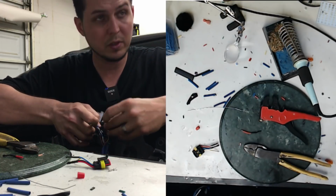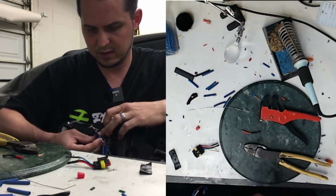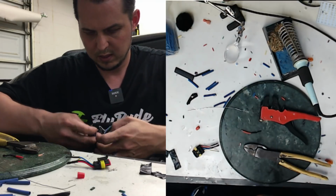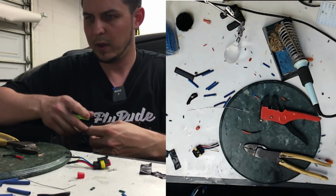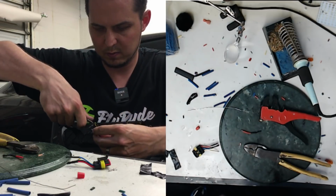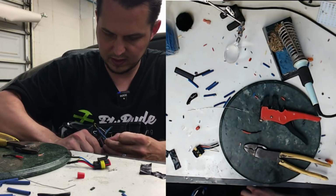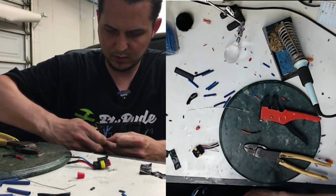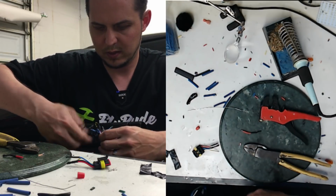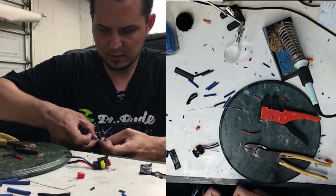So here's a trick for anybody that's listening. When I set up a strobe unit to turn on something like the white DRLs on a GTR, I need to put a diode on there because it's a secondary power source, right? So what that means is that I'm powering it the normal way, which is from the parking light on the car, but then I also am powering it from a secondary way, which is the strobe, and I don't want those two different ways to see each other. So you have to use a diode, and people that know electronics are like, yeah, no kidding, it's a diode. People who don't know electronics are like, what the hell is a diode? So that's why I say it. It's like a little one-way valve. It only lets power come in from one direction.